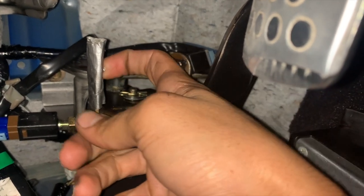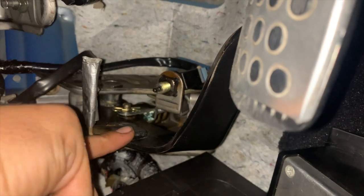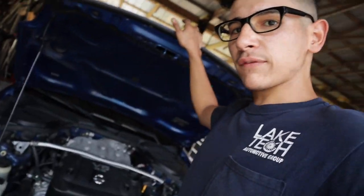As you can see I've got duct tape here — I need to get that rubber grommet or a bolt and nut so I can push the sensor in. Every time I start the car I have to reach down and push this button in, which is getting annoying. But the car is completely done — the clutch pedal is bled and adjusted to the proper specs. Now it's time to start this thing up and go for a quick cruise to see how the clutch performs.